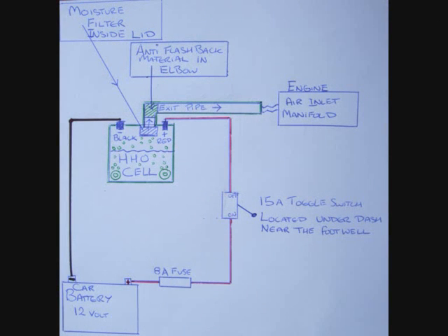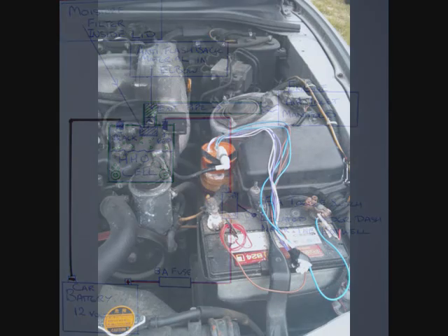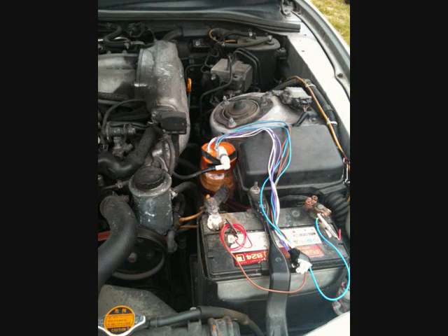In this section I will talk about the circuit and location of the vessel within the engine bay. This circuit shows from the positive terminal going to an 8 amp fuse. This is how I have it wired at the moment but will eventually be taking the power from the fuse box so the ignition switch from the key socket will be in circuit for safe isolation. I soldered all terminals from the battery to the fuse holder. Next is a 15 amp toggle switch situated within the upper area of the footwell driving position. I used 2.5mm cable which is a good thick core to carry the amperage and soldered all ends onto the spade connectors for better connections. In this still picture of the engine bay it shows my old vessel in the perfect position, located in a good airy space a few inches away from the battery, the air inlet manifold and the fuse box.